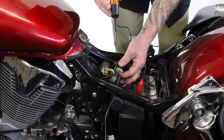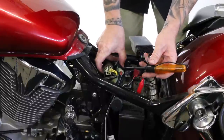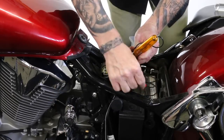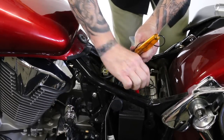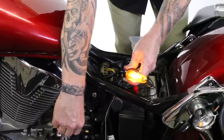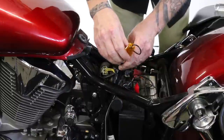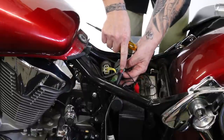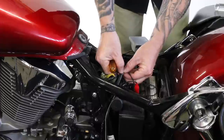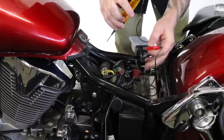What I mean is one that switches on and off — that's going to tell the stereo to turn on or turn off when Kevin turns his key on. Ryan's going to start probing here and he's found one he likes. Once he gets it probed, he'll turn the switch on and off — he already found one. That's the wire we're going to tap into to use our remote power. It happens to be red with a black stripe on this bike. There's probably several wires you can hook into — you just need to use your tester and find one that switches on and off with the key.